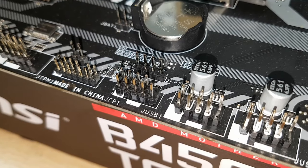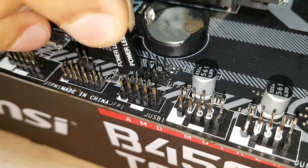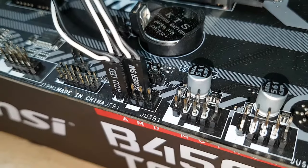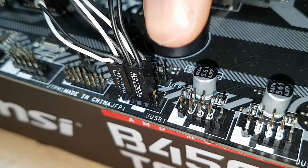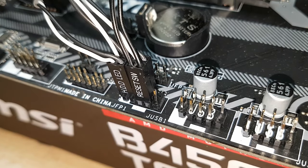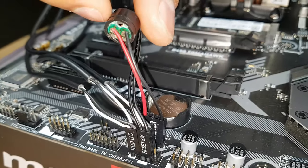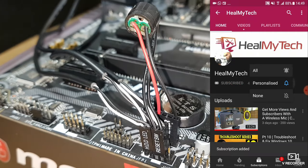So we start with the top left — power LED positive and negative. The top right is our power switch — easy peasy. Bottom left is the HD LED, and last but not least the reset switch, which is a two-pin cable. This is also where you'd use the third reserved pin if you had a three-pin cable. And for reference, let's put the speaker cable in just to be thorough — note this is a reshoot as my previous speaker cable broke. And that's it, you're done!